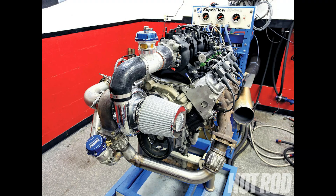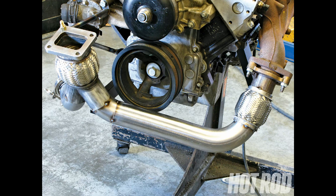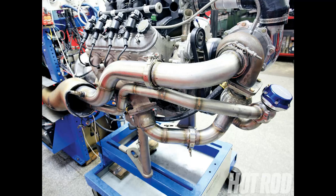I plan on running the exhaust manifolds into two and a quarter inch tubing. The two will merge into a T6 flange, and I'll have the wastegate coming off that area as well. I'm undecided if I'm going to use any flex tubing — I might use a bellows before the turbo. Let me know what you guys think about running it without a flex.